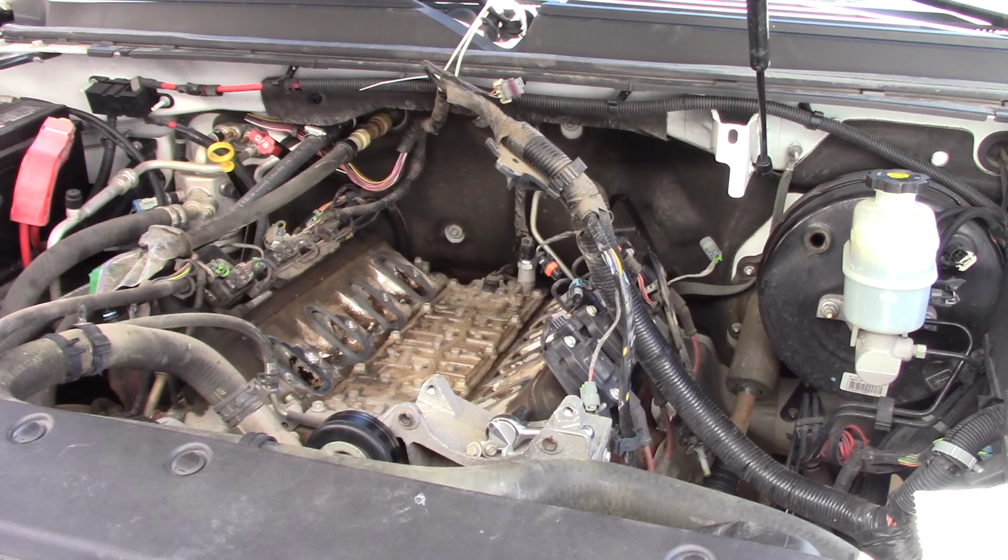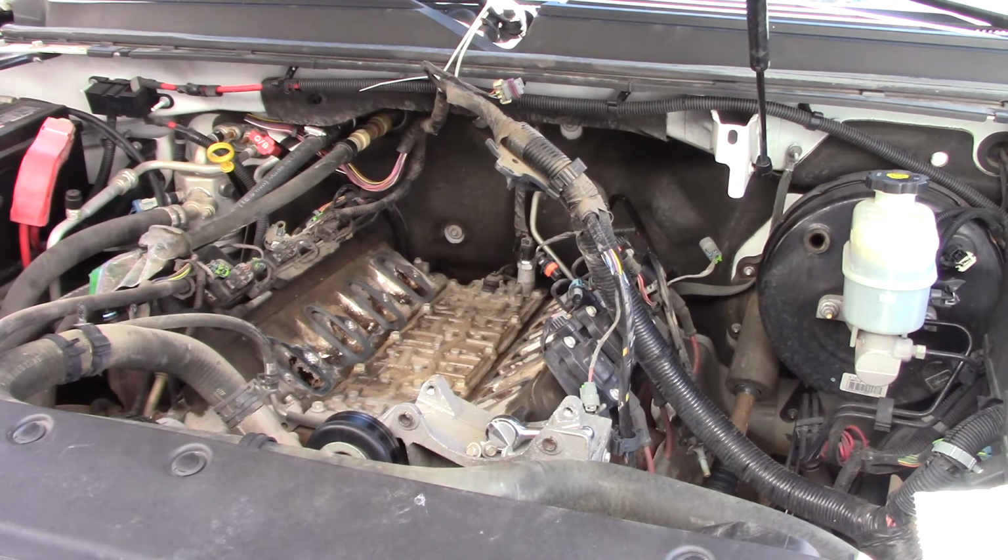This actually tells me though that there is an injector starting to go bad, and the gaskets with 200,000 miles is probably not a bad idea anyway, although I wasn't really seeing a vacuum leak. At least I wasn't getting a code for anything like that. It's still a good idea to kind of look this stuff over. This thing, I don't know if it's had plugs and wires on it. The plug wires are red. I can't remember if that's factory, if those are aftermarket AutoZone specials or not. But I probably will replace those too.